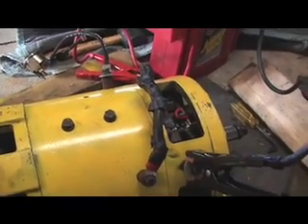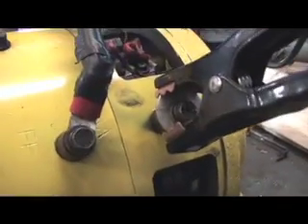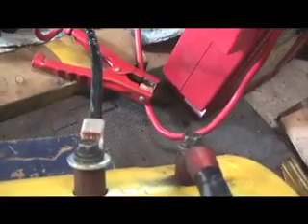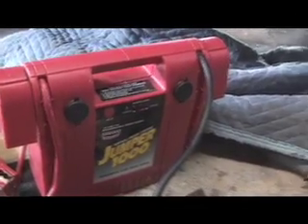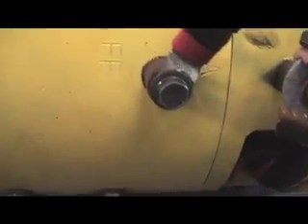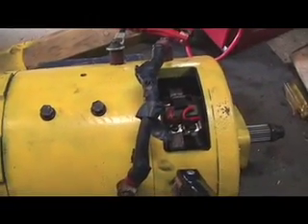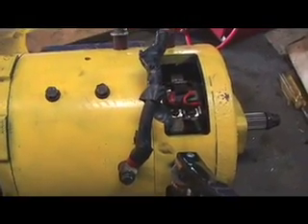Fortunately, this motor has four power connection posts on it. What you do is you jumper one of the power connections to the other to complete the circuit. Yesterday when the motor spun the wrong direction, I had two of the power posts right next to each other jumpered to each other, and then on the other side put the two power connections using a battery backup jump starter as my 12 volt power source. So what I did today was jumper kitty-corner, so that the polarity between the field and the rotor electromagnets is opposite from what it was yesterday.